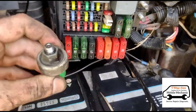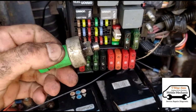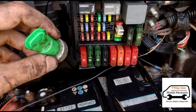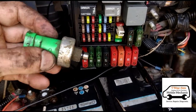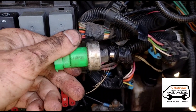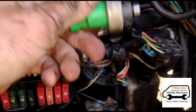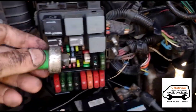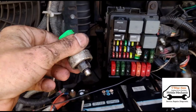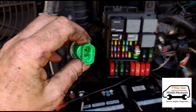That's it, all in — and here's the old unit. What this is, is a parking brake switch. Basically, once you turn the handbrake off or on, it's just staying in position where the motor is constantly pumping and getting really hot. It's not switching off — it should just come on and then instantly go off once the handbrake is released.